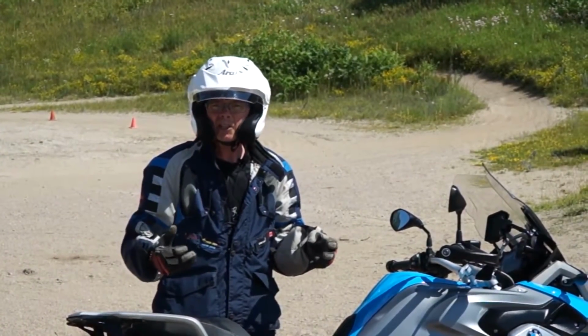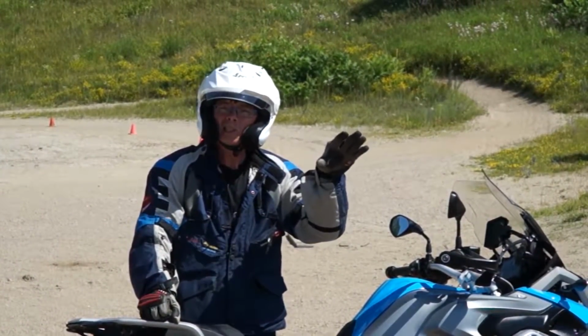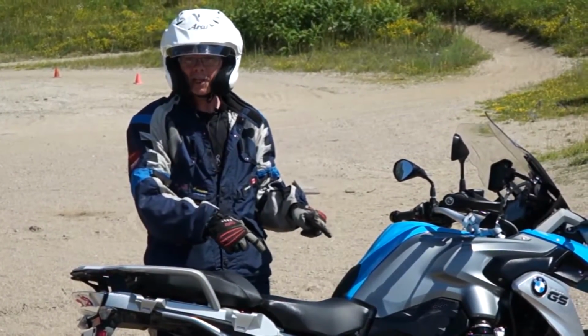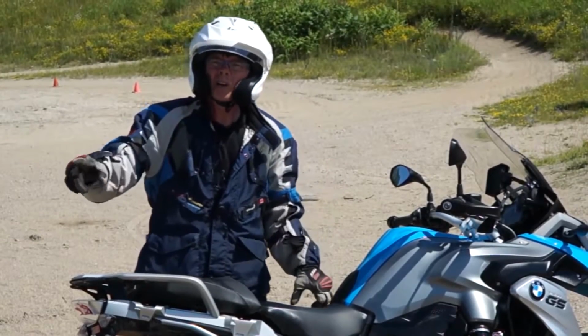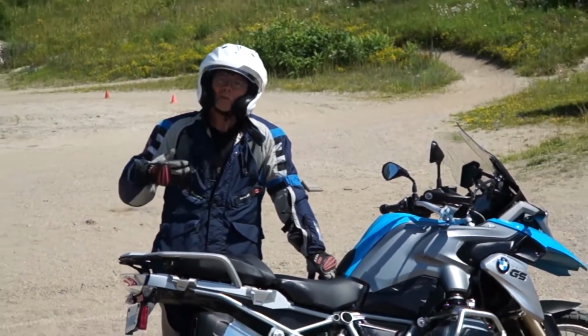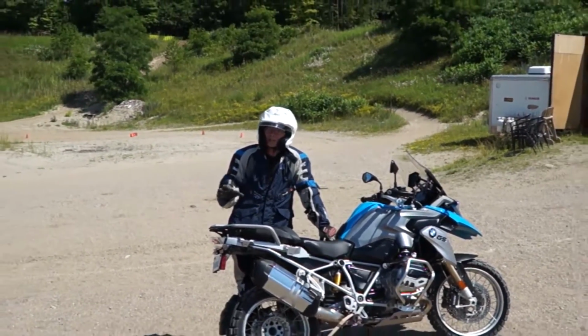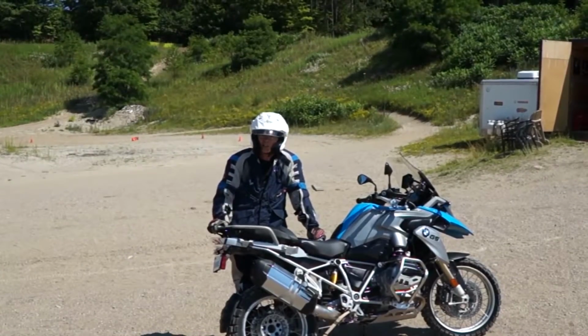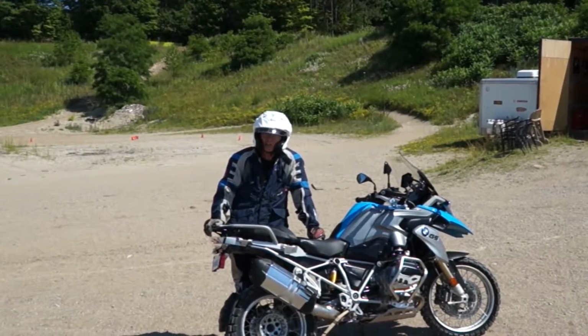You need a little bit more energy. And you don't want to pop out the clutch, because with a lot of weight on, you could wheelie the tow bike, or it's a real jerk move off for the person on the bike being towed. Again, riding gear, practice it on small bikes. If possible, borrow your friend's or your husband's bike to practice.